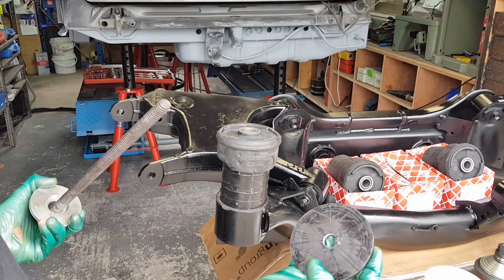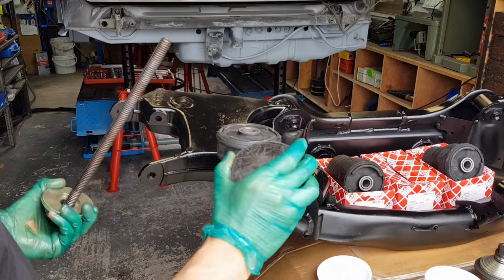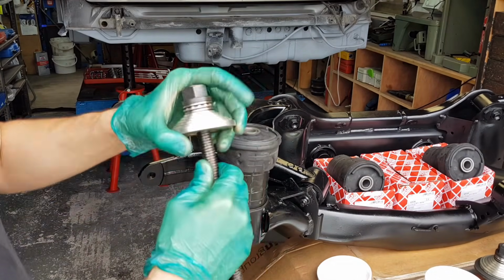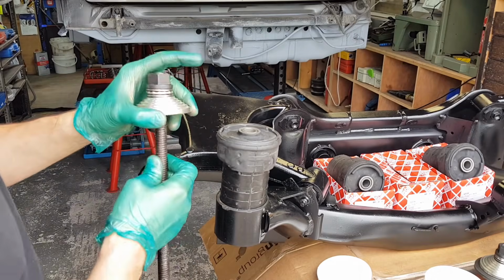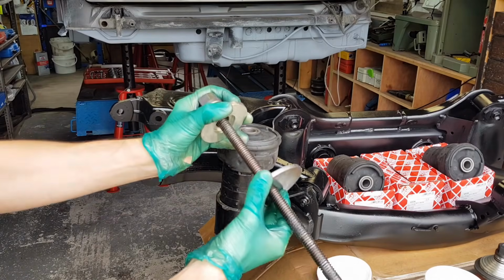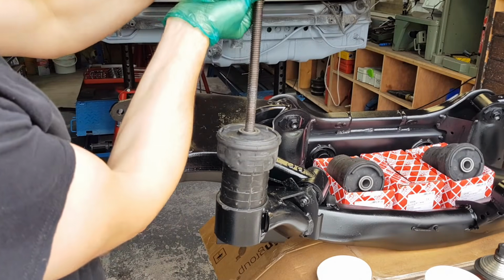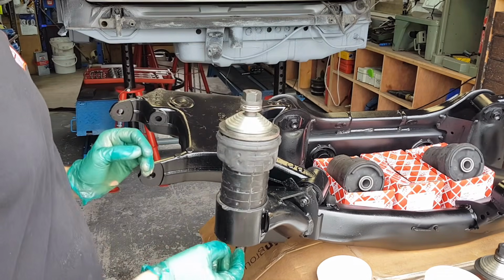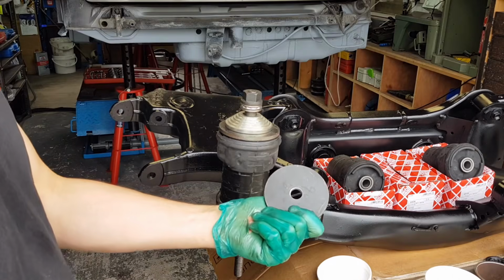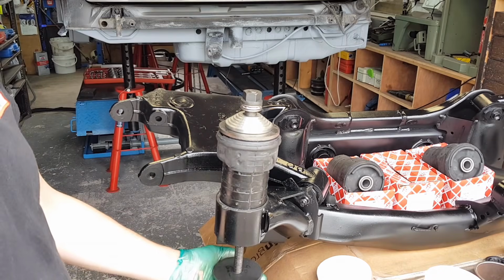And this is a 100mm steel plate, 6mm thick. And what I will be using is this threaded rod with axial bearing. I will place it like that. Hopefully you're seeing this okay on the camera. Now insert this through the bush. And then in the next step, I will simply be using another plate. This is 90mm diameter. I've bored it so I can put it through the tool.